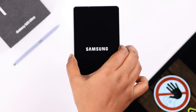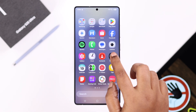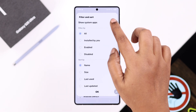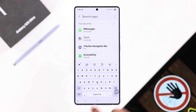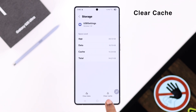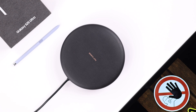After that, take out your S25, turn it on, and before charging it, open Settings, scroll down to Apps, tap the downward arrow, select 'Show system apps', and press OK. Then search for USB, enter USB settings, go to Storage, and tap 'Clear Cache'. If there is no hardware issue, your problem should be solved.